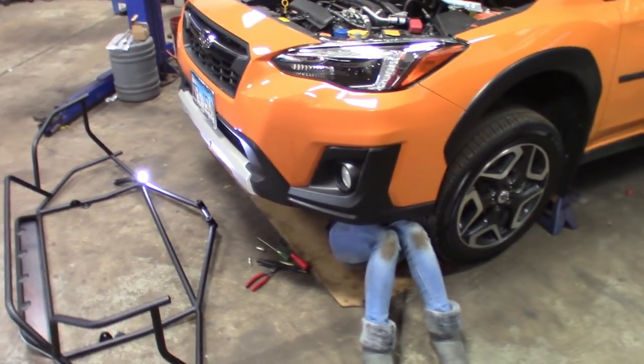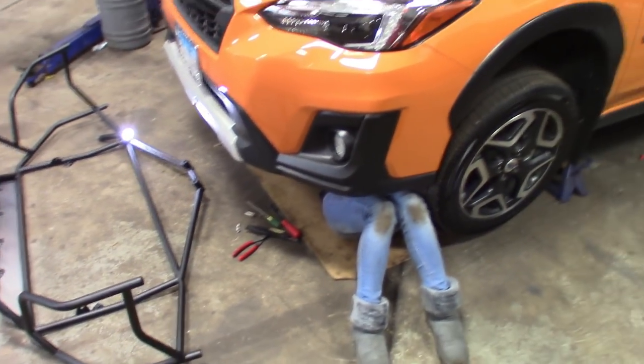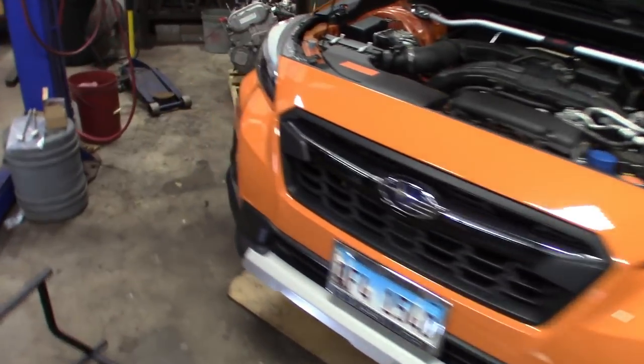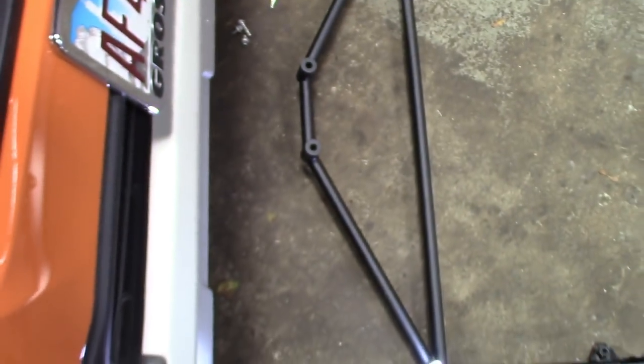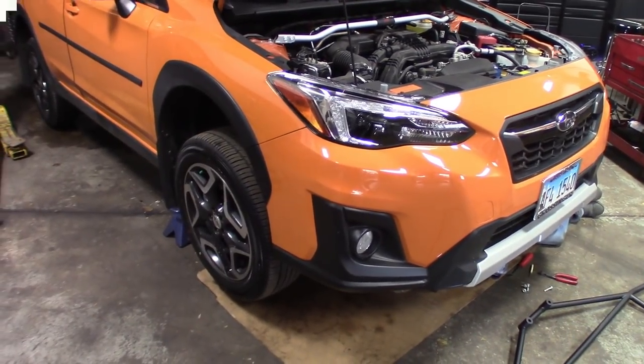All right, so first step is to pull the plastic skid plate out from under there. Got Lauren working on that real quick, knocking that out for us. And then we got to cut out a few sections, a couple sections on the side, to make way for the side supports, and then they give you the hardware for the back support, to support the back two right there. There's some longer bolts. So getting that knocked out, we'll get the skid plate out of it real quick. We'll show you where to cut out these holes. We'll get right back with you.